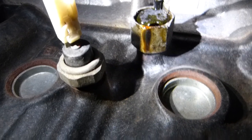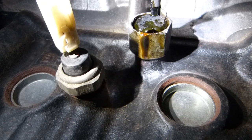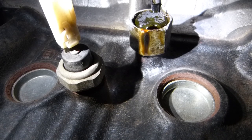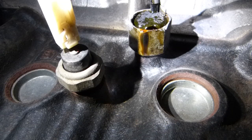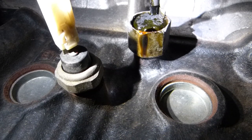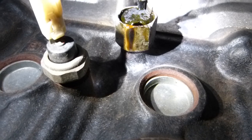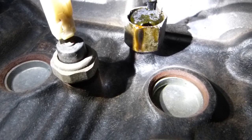Reasons for low oil pressure could be obviously one, not enough oil. But some of the oil passages could get clogged if you don't change your oil regularly and you are circulating sediment around the system. Some of those sediments can build up and clog some of the passages for the oil. And when the passages are clogged there is not enough pressure to activate this sensor with this push plate against the spring's force.